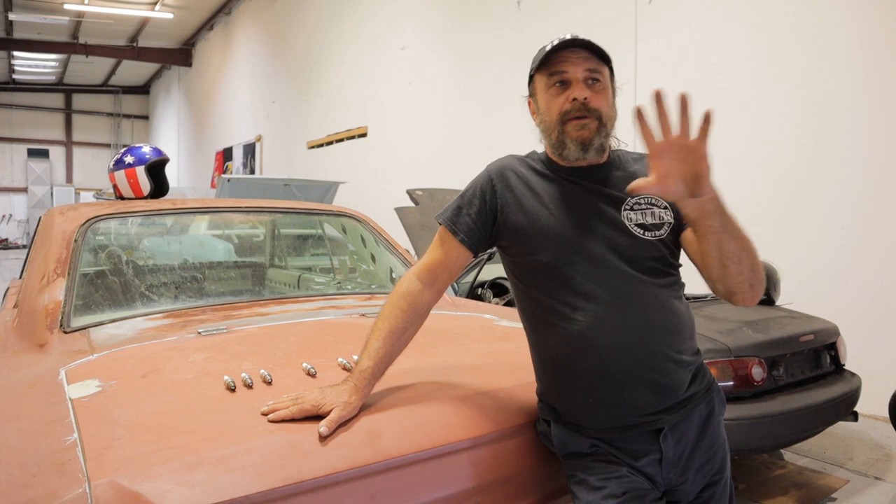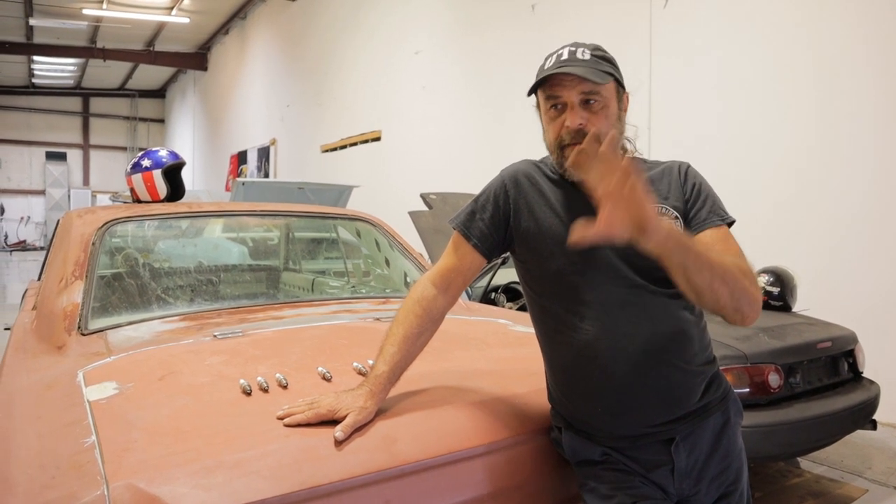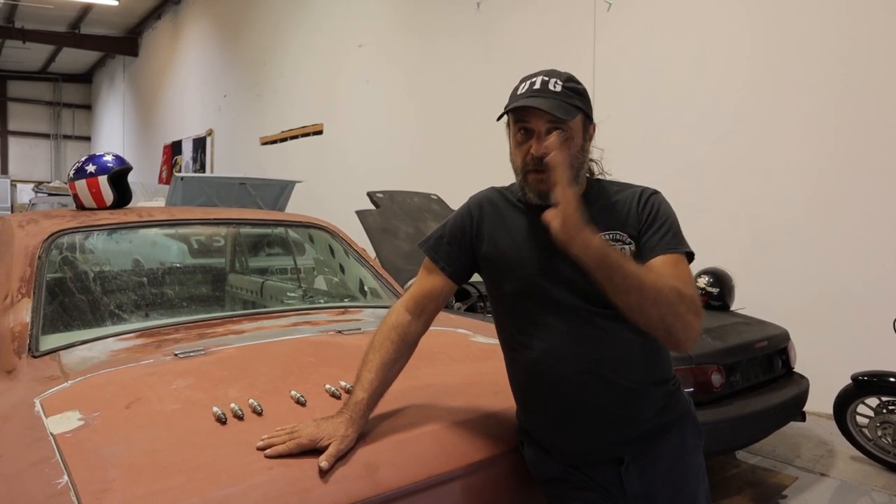Let me give you a background on what brings us to this point. In the last couple of videos we talked about idling and fuel flow through the engine and the measures we took to correct those things. So now we have an engine that idles clean and smooth at 1,000 RPM. It doesn't foul or dirty any plugs in particular — it could be a little cleaner, but it's fine. We made a full throttle run and we were dead lean with some weird distribution. So we staggered the jetting on the carburetor, increased it, and needed to make a good hard run.